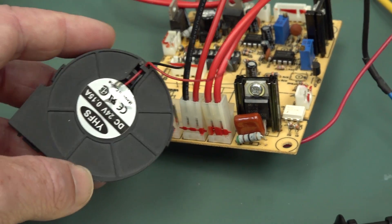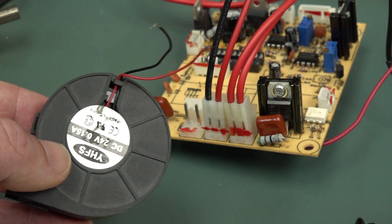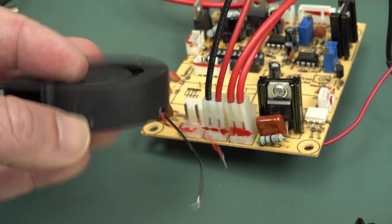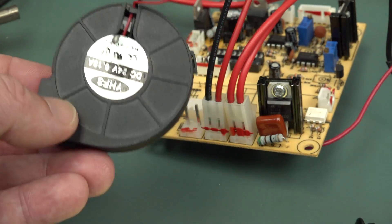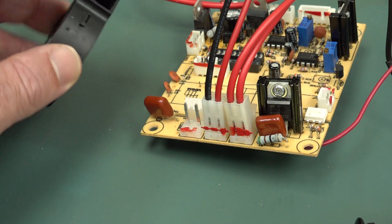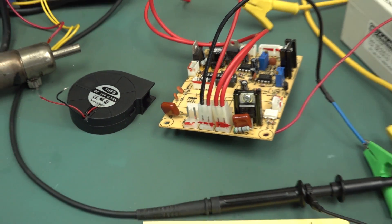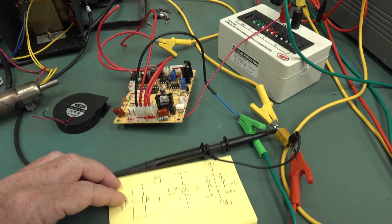It was kind of too much of a coincidence to me that the fan also failed. I can't think of a mechanism where if the TRIAC failed short, how that would really kill the fan — it could have melted the coil or broken a connection, but I can't see that happening. Likewise, it's hard to see how a fan failure would cause a short in the TRIAC. I've measured it and it hasn't failed short — in fact it seems to work just fine. Spoiler alert: it's working, so it's not actually the TRIAC.